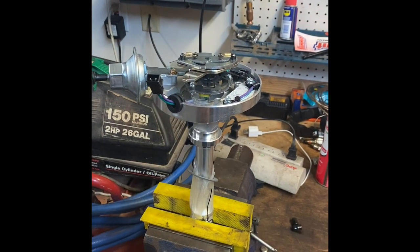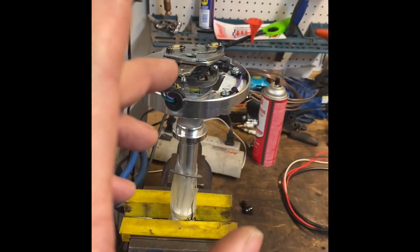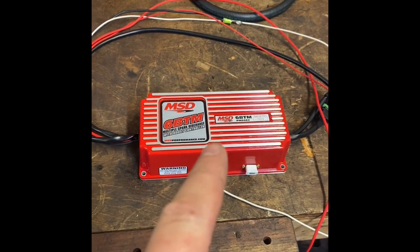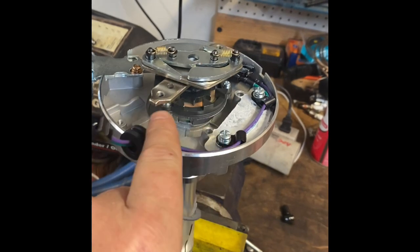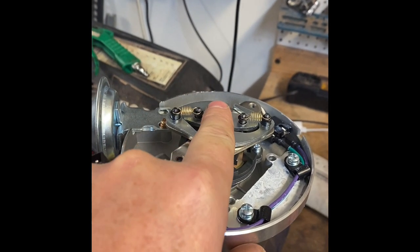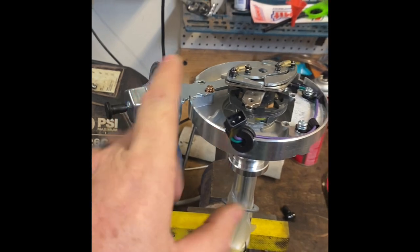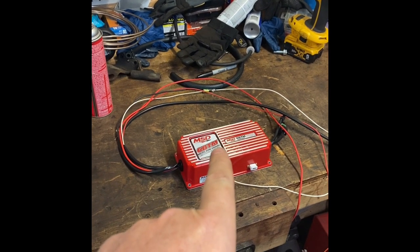T-minus six days, it's Saturday. I'm leaving next Saturday for sick week and we're cutting it close. For the ignition system, I'm running a standard GM HEI style ignition from Proform — it said 'race' on the box, it was a hundred bucks and had good reviews. I'm also running an MSD 6BTM, which is basically a 6AL type box that pulls out timing based on boost, adjustable from zero to four degrees per pound of boost. We pulled the guts out of this and put the MSD harness in there. Blower motors like a lot of initial timing, so I got the lightest mechanical advance setup I could. It brings all the timing in real quick. I wasn't going to run the vacuum advance, but I think I'm going to — so we'll have a lot of timing down low for cruising, and then pull timing out up high when the boost goes up with the MSD box.